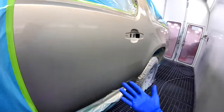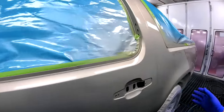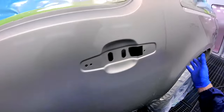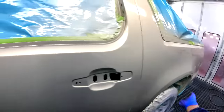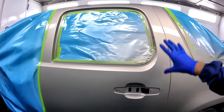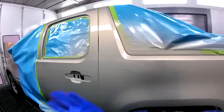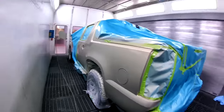You can start the drop like that as well. I had a primer spot here so I was blending that way the whole time. Make sure you're tacking this every coat up to your control coat — after your control coat, don't tack anymore. We got a nice uniform finish: that was three coats of base and a double control coat, and it looks great.